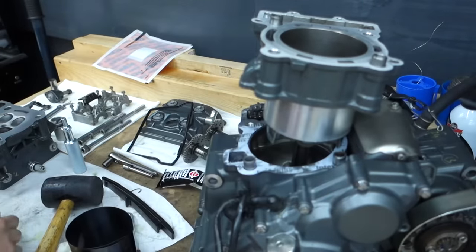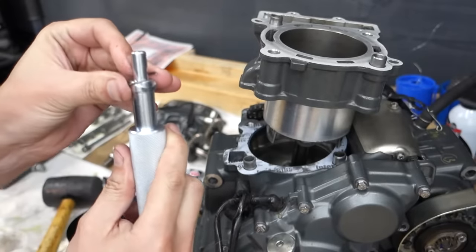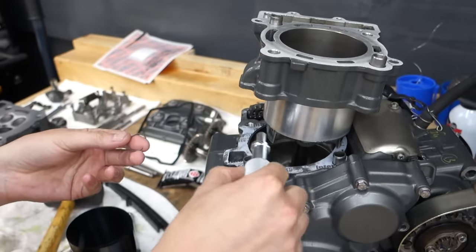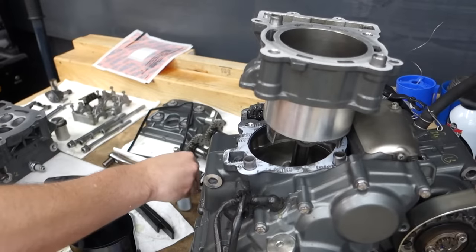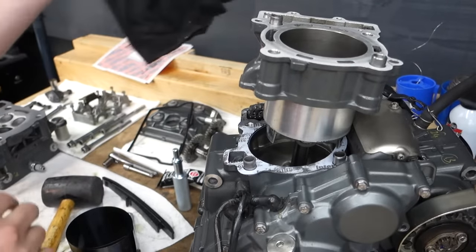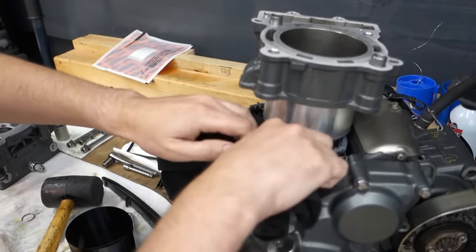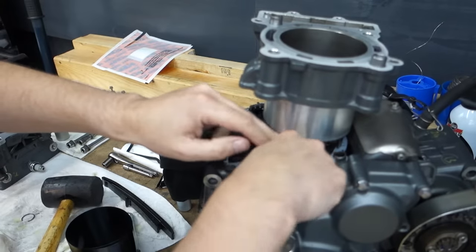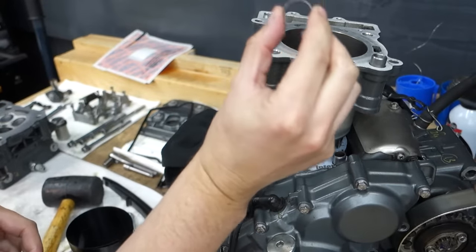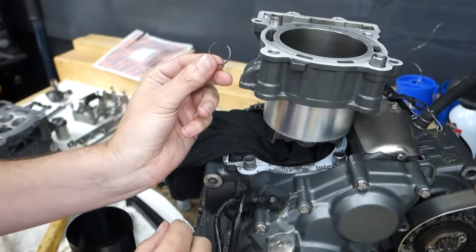This thing is in. Now I picked this up - this is a $30 tool from KTM. I thought I could just put the circlip on with it, but it doesn't fit that way. It does fit in there and allows you to seat the circlip, so it is useful. I'm going to cover the crank so I don't drop the circlip down there, which I absolutely like to do. These circlips go supposedly in the six o'clock position. The one on the other side is at twelve, and it came like that installed from KTM.